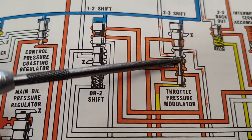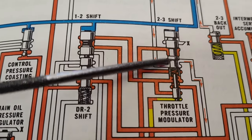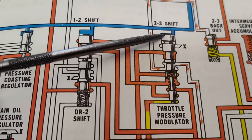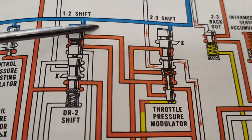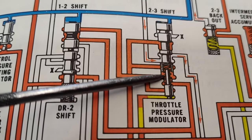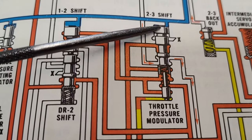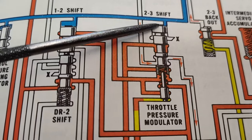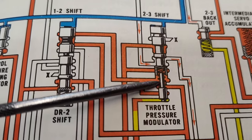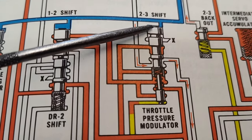This here is your 2-3 shift valve. Oil is on the back side - this blue oil is the governor pressure. This pressure varies and pushes the valves down on the 1-2 and 2-3 shift valve. You can see that blue governor oil there. This line oil is on the smaller area of the valve, and it's opposing the larger area, but this pressure is also less. So what happens here: this downshift valve sends full line pressure to the opposite end of this 2-3 shift valve.